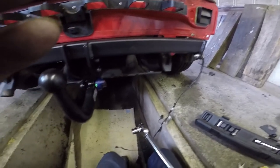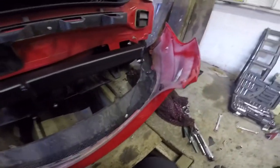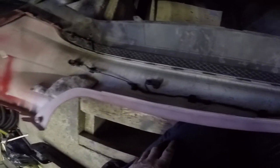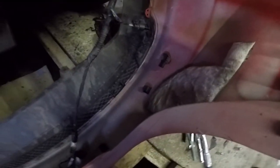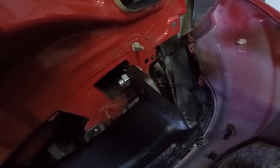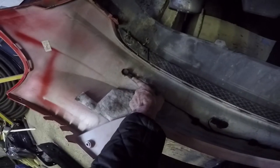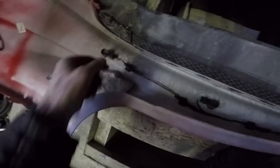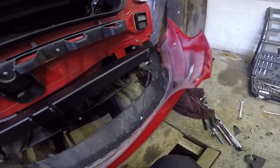I'm going to do all the bolts and then get the bumper back on. Putting the bumper back on, double-checking it's all in place. These wires that feed the sensors at the bottom back of the bumper — I decided to unclip them all. There is a main connection at the back — a big connection — if you can get that one off, but I find it a bit tricky, so I've taken the four sensors off individually. Just press this little clip down here and slide off.